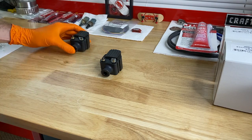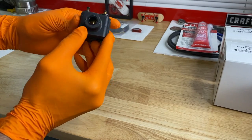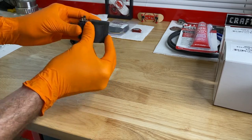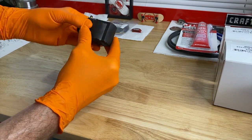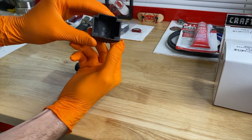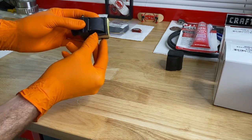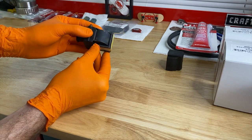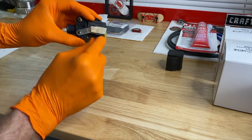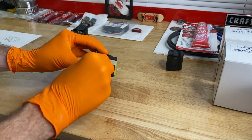I've repositioned the camera. Setting the good ignition coil aside, I'm directing our attention to the one causing the issues. It has that discoloration inside. You've got your positive terminal, your negative terminal, and a little grounding clip. Then there's a large rubber casing or protector boot — I'm going to carefully pull that off. And our service manual states you need to put RTV silicone inside those connections. It doesn't seem like whoever did this last put it in there. And — oh look — there is a crack. No crack on the bottom, but a crack on top. That is a big issue.